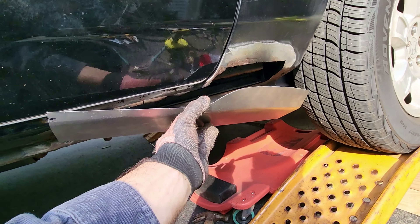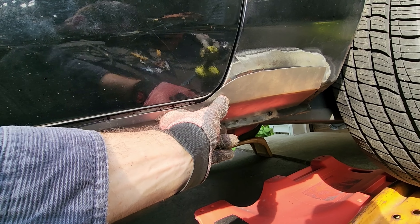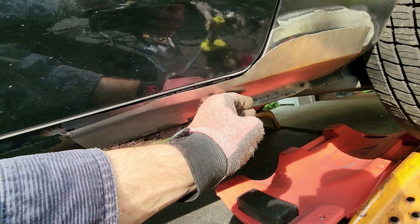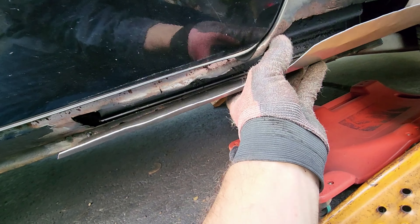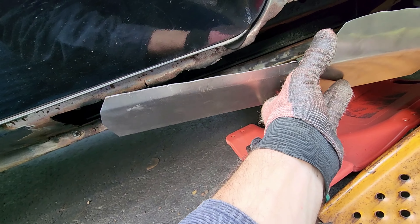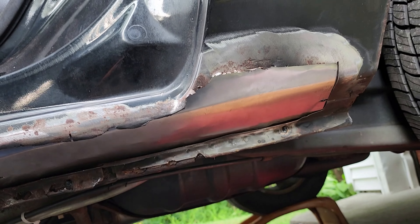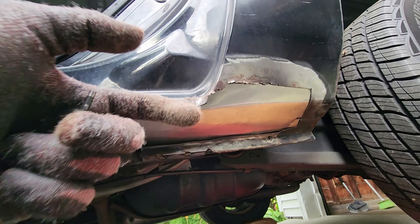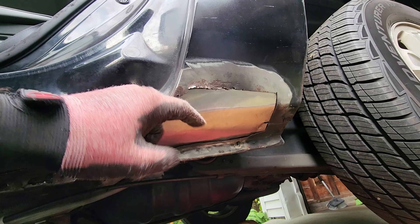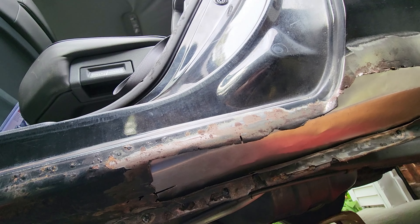I'm getting close. I need to tweak it a little bit, take a little material out of here. I think this is very close to what I want. Now the age old question — I want to get this on the inside. How am I going to fit it inside there? This is going to be fun. I got it in there with a lot of finessing. I had to trim the edges really close and I finally got it in. Now I got to make sure it comes outwards a little bit so that it gets nice and flush with the existing sheet metal. Then I'll tack it into place.